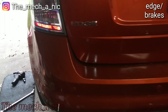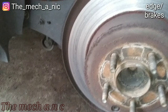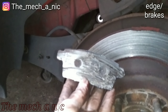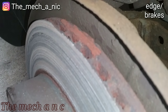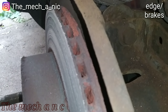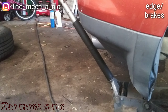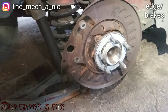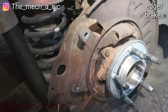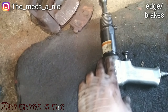The Alero is all set. Now we have a Ford Edge — rear brakes. These rotors were way past due. AutoZone gave us incorrect parts, so the owner had to go back to exchange the rotors. Meanwhile I decided to get a jump start on the right side. As soon as I pulled the rotor off I noticed someone did a 'stage one weight reduction' — the parking shoes have been removed.